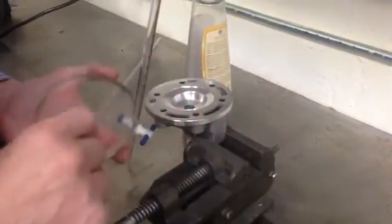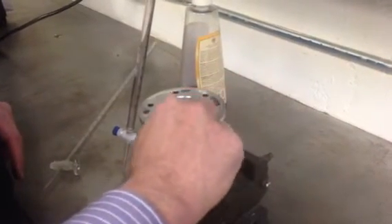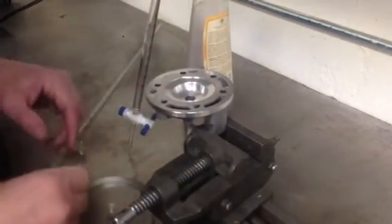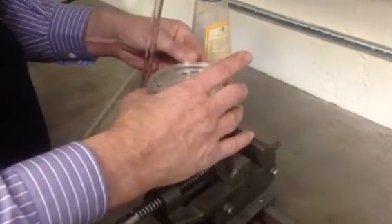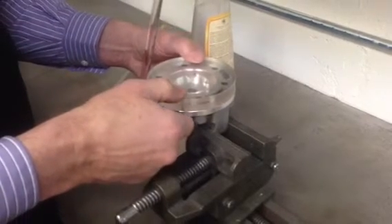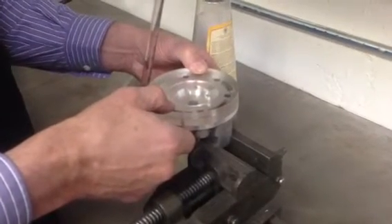You've got to seal the plastic plate, and I just use a thin grease — any type of thin grease. Just make a decision and pick some; anything super thin is better. I put a very thin coating on so it doesn't squish out into the combustion chamber. The head is set in this little vise at a slight angle so that the air will go uphill and come out the bleed hole. I carefully set the plate on, and this particular plate is perfect for 250 and 300 KTMs. Push it down under the grease and turn it slightly to get it to really stick.